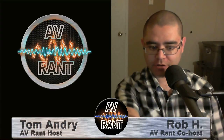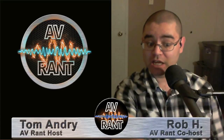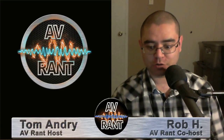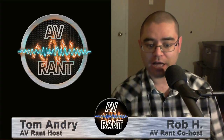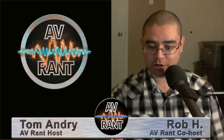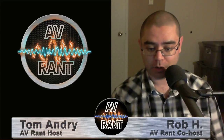You have the magic letter on the end of that, the A in WA, which signifies that you do have HDMI 2.0a with HDCP 2.2. If it was an X7200W, that was prior to that upgrade. I'll trust that you have that correct, and that being the case, you should be able to pass through the signals just fine. It should pass HDR10. It's a projector, so we're not worrying about Dolby Vision at all. But if he just has the W, can't he contact Denon and have it upgraded? If it were the W, you would have to physically send it in to Denon for the hardware upgrade.